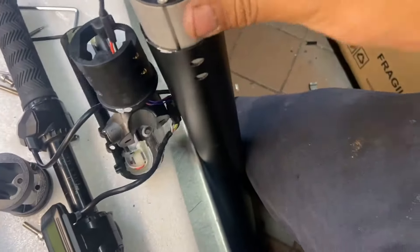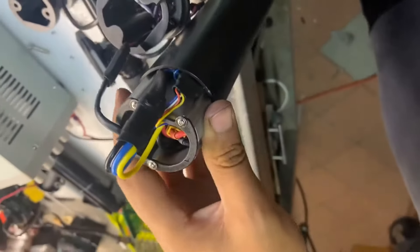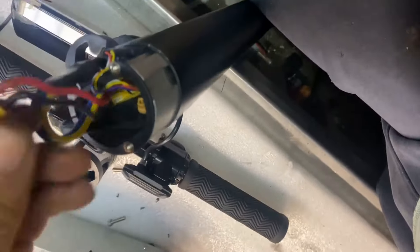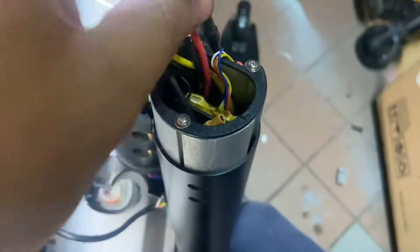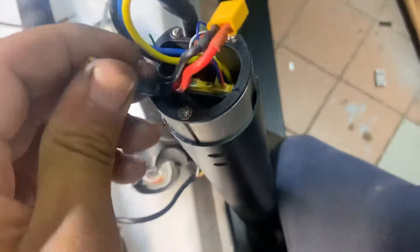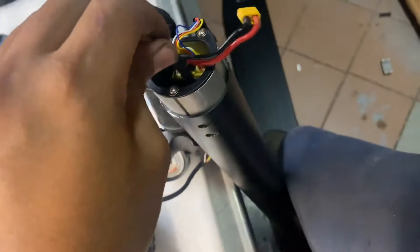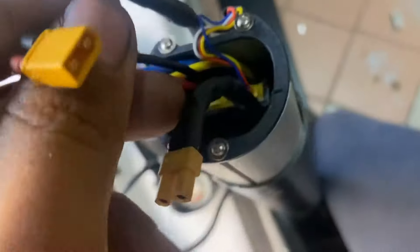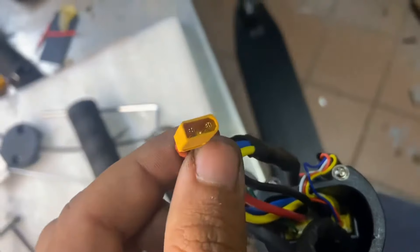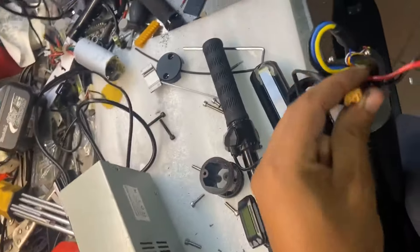In this case the motor controller is a lot smaller than in some other ones, and the wires are kept behind. This is what we're interested in — the plug that goes to the battery. In this case it's here, and this is the male XT30 plug. That's the one connected to the battery, and the other one goes to the motor controller — you don't want to meddle with that one. You want to work with the battery plug, so put your multimeter on there and measure it. When the battery is flat it'll be low.